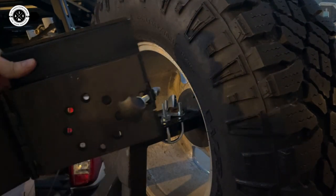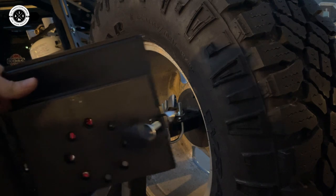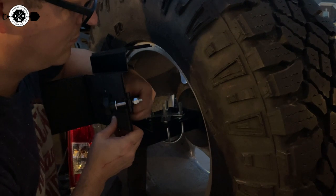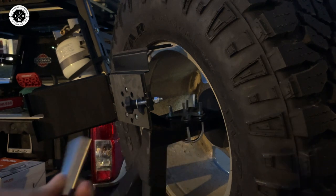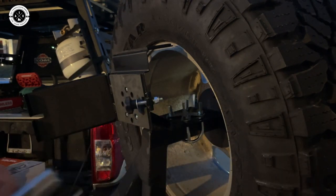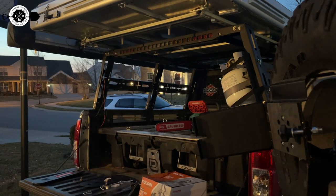The sandwich mount itself mounts with a few little bolts with nuts that go through them. You put the bolt through so it flush mounts back inside the foam so it doesn't rub against your chainsaw bar. The small nuts on the back are 7/16ths, and the head of the bolt is Phillips head. I'm going to use a Phillips head screwdriver to hold one side tight and a socket on the back to tighten those nuts up. Since we're losing the light, I'm going to use my newest addition — this pre-lit bed kit.